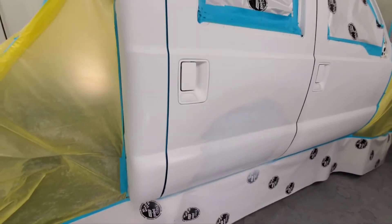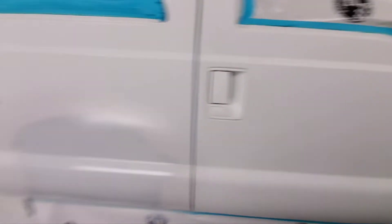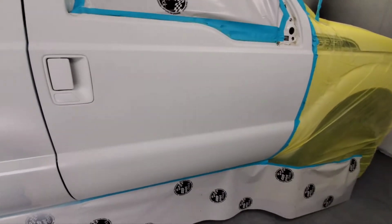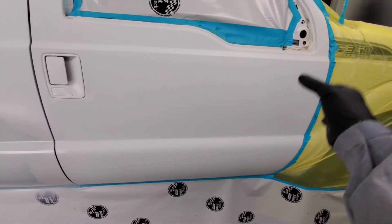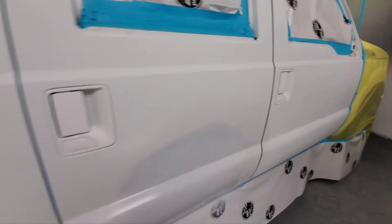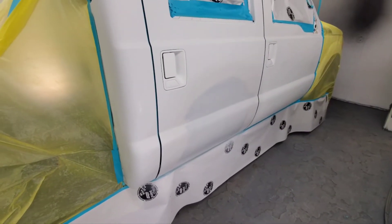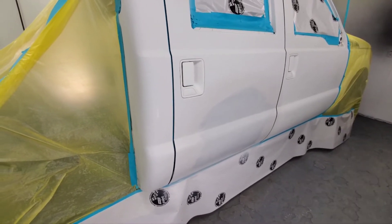I just go back and forth because I get a nice clean overlap each time. Or if you arc and try to overlap and fill the middle, you might put it a little bit heavier in some areas and risk some runs — but just practice. For my next coat I'm going to put one coat in this area to get coverage, and on my second one I'm going to try and use the body lines to hide my color and blend it as far out as possible. The customer knows it was damaged here — I'm trying to put my color and blend it all the way out there to keep his eye off what was damaged. So if your color isn't 100%, you blend it further away from the damage area. I already painted this box side, so I can spray all the way there — and if your color is pretty close, with a bit of a gap it'll be hard to tell the difference for most people.